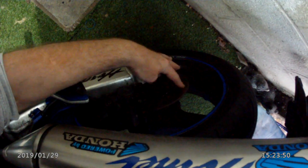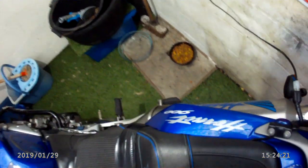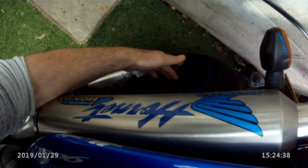Like I said, I've noticed that's actually smoothing out — it's not quite as bad as I thought when I asked up last year. Why do you need a new disc? Because I messed up last year. Every time I applied the back brake, when I was testing that new camera, the camera picked up this metallic grinding noise. It didn't twig for me to check what it was, and after a couple of weeks the disc was scored to hell and the bloody pads were non-existent — worn right down. Therefore I've got this disc, because I'm worried it might be too thin now it's worn all the grot away.